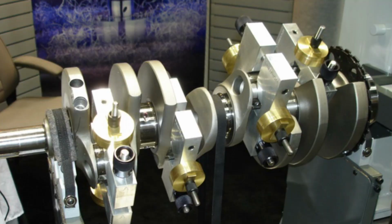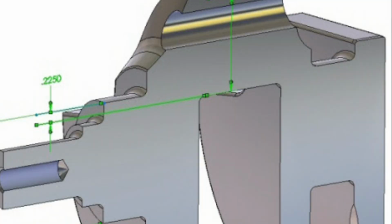So aside from understanding those basics, there are some more advanced options you may or may not have depending on the manufacturer of the crank. One of those is the design of the counterweight. Now the counterweight can be made, and the two separating factors here are it can be either made for ease of balancing, or it can be made for the loading on the main bearing. The counterweight ideally should be 180 degrees off from the pin. You have a counterweight here and a piston here. That ideally should be 180 degrees across, and that can vary depending on the manufacturer. You may or may not have an option on that, but the counterweight that you choose does play a role when you get to the point where you have to balance the crankshaft. Those counterweights can also be designed to reduce weight and windage.